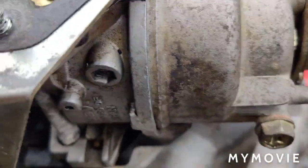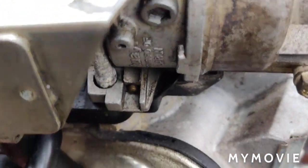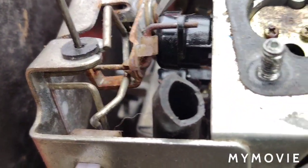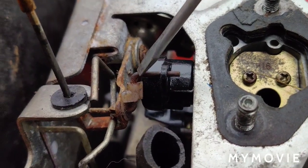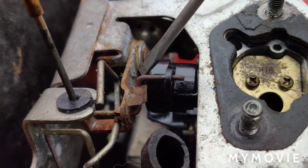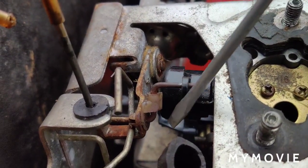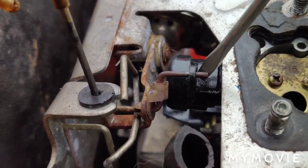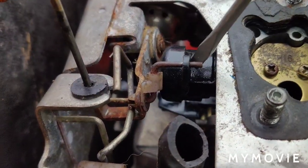Okay, I had to bring you back for a second. If you see, where the heck am I here? Oh, okay. Alright, so there's this rod here. It goes into the choke assembly here. So this rod, if it's flipped around the other way, you can still hook it up to this, but the choke won't work. And I found that out pretty much having this completed.